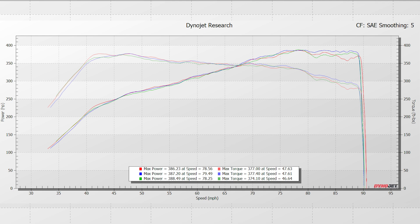We just got done testing the AMS top mount intercooler and it made about 388 horsepower and 377 foot-pounds of torque — some pretty good numbers. But really the purpose of this test is not to compare horsepower numbers; it's about the consistency that the intercoolers have between runs. We're going to be monitoring charge temps and find out how well the intercoolers respond to heat soak when we do those back-to-back pulls.